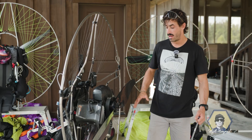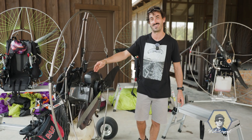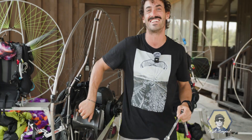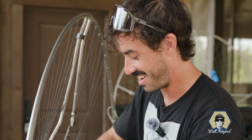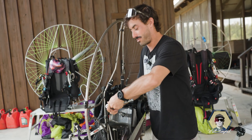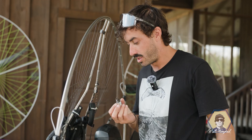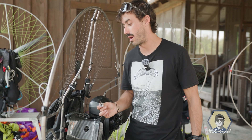I have an idea. I wanted to fly this motor, so I set up the glider and everything, and then I went to pull the rope and it sounds like it's locked up. It's stuck. That's a good sign that the motor's burned up. He said he thinks it's out of gas, looked at the gas, and it's clear — looks like water. If you know anything about flying these, the oil has color. I'm going to take the spark plug off — it's going to tell me a lot of information. I just cracked it loose. Actually, it looks normal. Color's great — correct mixture. That's a color I would fly in, like coffee brown.